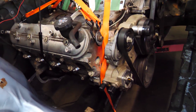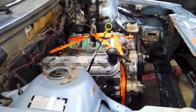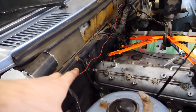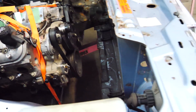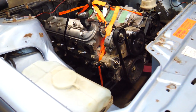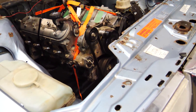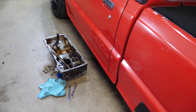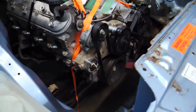It is more or less in. It's a little bit tilted upwards because the transmission is now hitting the trans tunnel. The problem is that the windage tray is already pretty much hitting the subframe, the steering rack, and the sway bar. Obviously this is much lower than the windage tray. Let's go ahead and try to fit the factory pan in there for the lols.